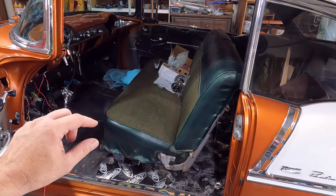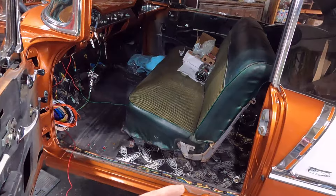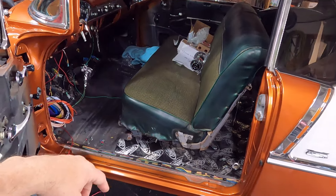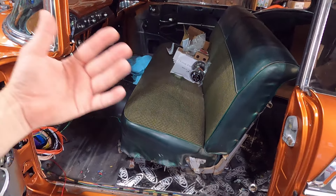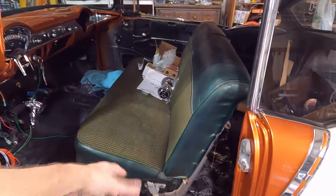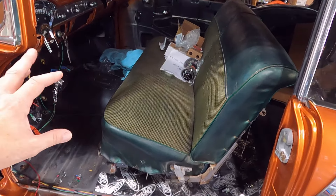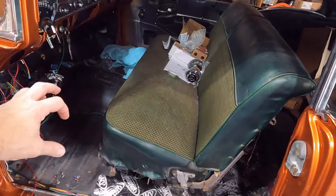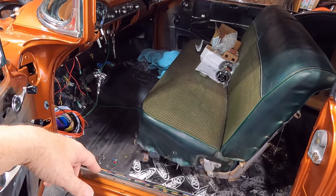If you put any other color in there, it'd be tough to match seat belts, carpets, and all that stuff. He's already bought black carpet — it's a one-piece ACC, Auto Custom Carpets, my favorite carpet bar none. I've put a lot of ACC carpet kits in all kinds of cars and trucks. They're pre-molded. For these cars you can get a two-piece or one-piece, and I always recommend the one-piece, especially with bucket seats, because the two-piece leaves open floor in the middle, which lets noise into the car. He bought the one-piece cut pile because loop carpet always gets stuff stuck in it and it's harder to vacuum out.